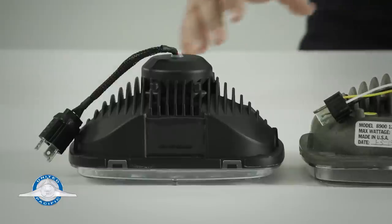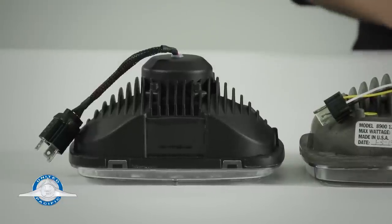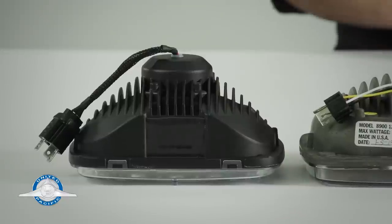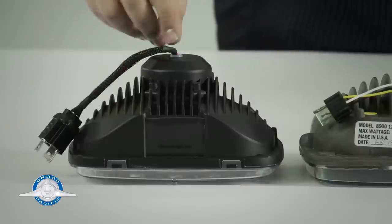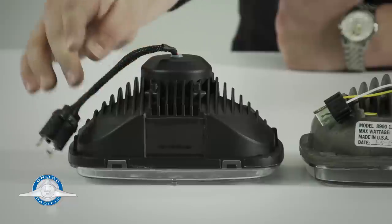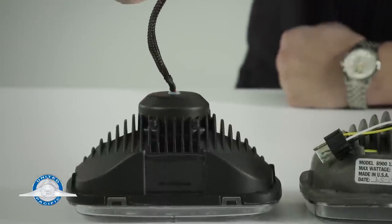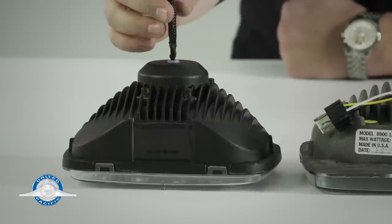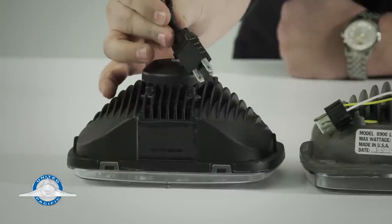The United Pacific 31297 is a really nice light for a few different reasons. First, the backside has a really nice rounded shape with no square, so it's very similar to the original sealed beam headlight — fitment issues are really non-existent. The top has a little aluminum cone area where the wires come out with an extra seal for waterproofing. The backside also has the part number and voltage input listed. The wiring is your three standard wires coming out, but it's wrapped in this abrasion resistant covering — something we haven't really seen before. This will keep your wires safe when installing and potentially smashing the wires somewhere accidentally.